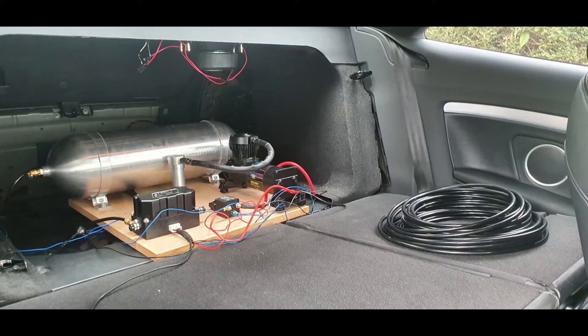We're at the rear of the vehicle now, and this is where the rear coil spring would sit. I've cut away the notch on the rubber where the spring would sit against, allowing my airbag to sit on top of it and locate inside it so it won't move around. A lot of people do remove these, but in my case the bolt I was given with the bracket wasn't long enough to fix it in place, so I've used this so the airbag itself can't move around.